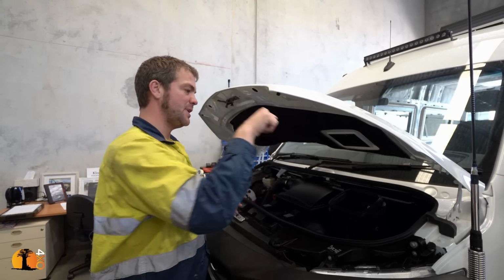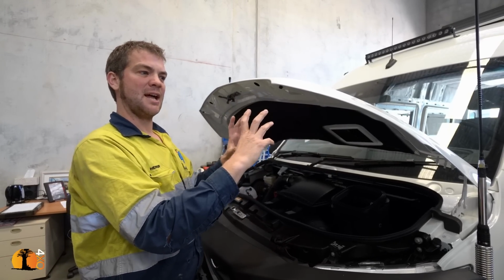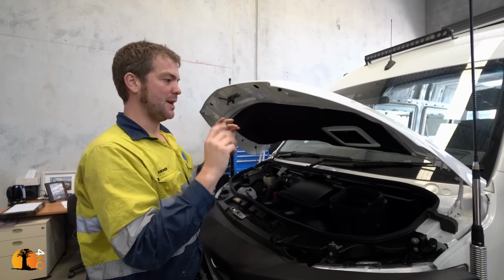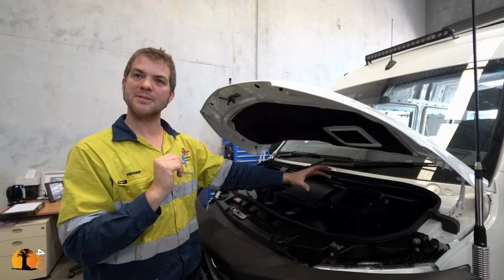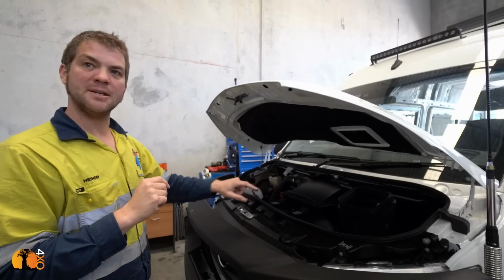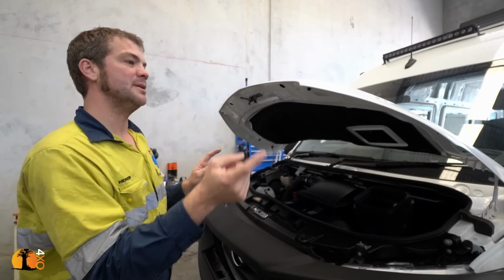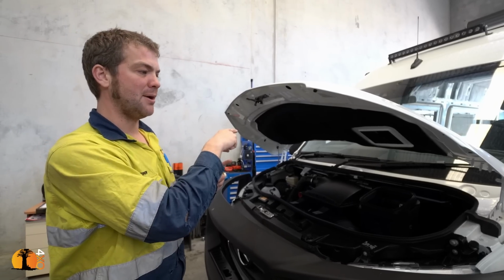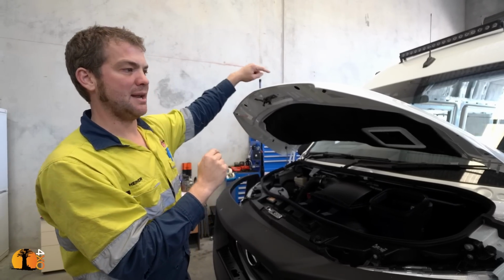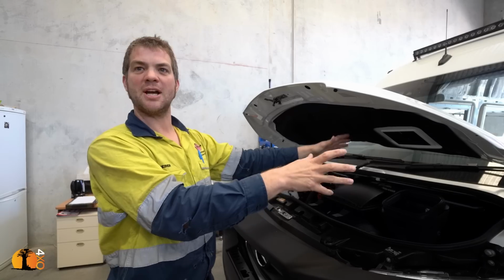So now if you connect the grid to it, the automatic transfer switch detects after 30 seconds of stable grid power supply that we are now connected to an external power supply and switches from the inverter to power supply from here, and everything on the inside will run off the grid. It also puts power to a dedicated power outlet that is only powered up when the grid is connected, and that means the Manager 30 detects now a 240 volt signal and starts charging the batteries.